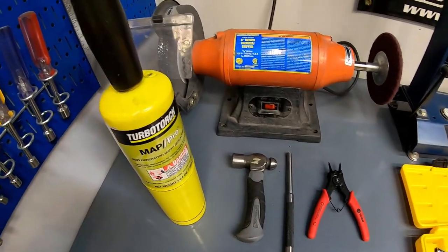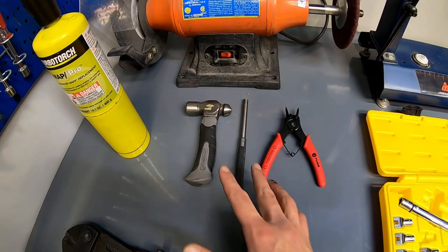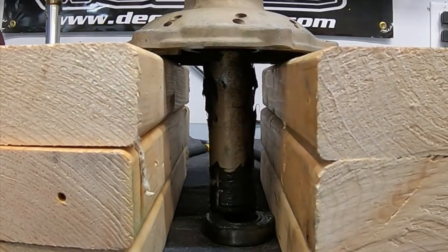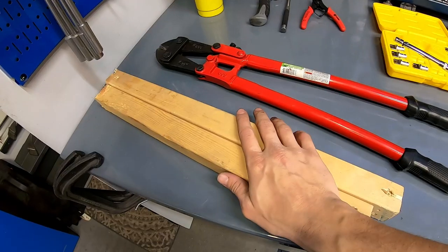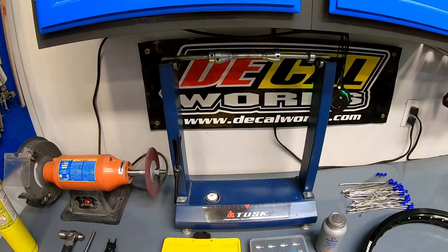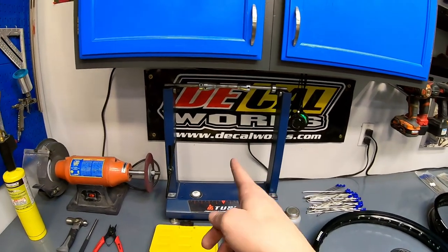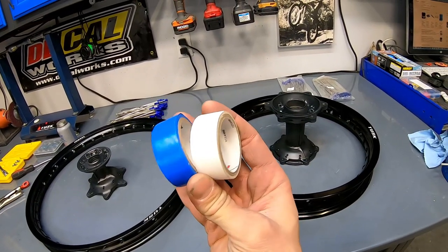The tools required for both removing and installing bearings are the same. A torch is very convenient and really helps bearings go both out and in. You'll either want a hammer and a tap, or a bearing driver kit. For some wheels, the hubs will have a circlip, in which case you'll need snap ring pliers. You'll also want a couple blocks of wood — about an inch and a half in one dimension is ideal — a spoke wrench or spoke torque wrench, and a truing stand. They're really not that expensive, and it's very difficult to get a wheel fully true without one. You'll also want anti-seize lubricant.